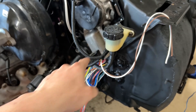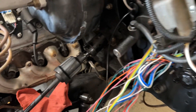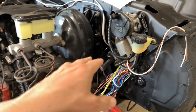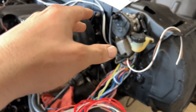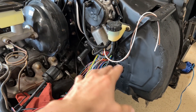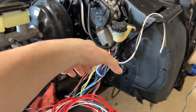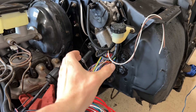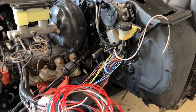My truck was a mechanical linkage clutch — I added the hydraulic clutch with that slave cylinder off of that 86. Put a whole new wire harness in here; it wasn't the OE harness with the plug, so I'm gonna have to get creative trying to clean up these wires. I think I'm gonna run a little gasket and use a leftover air conditioning piece to cover that.